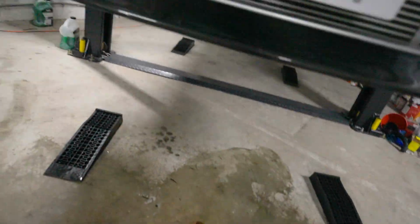But for the most part, it's holding coolant, which is good. Double checking there's no drips. At least it's holding fluids, and then we'll probably do another rebleed of it later as well, just because it wasn't the highest point. I'll probably do it another time because I'm tired. I'll get home and then we'll bleed the system again. It might heat up a bit. It won't overheat because it's pretty full, but yeah.